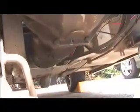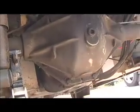Unlike the Commuta Car, the City Car does not have a hatch in back — the back is just a window, it does not open at all. Down here you can see the suspension is very simple: just a couple of leaf springs and some shock absorbers. And the motor, you can see back here, bolts directly onto the differential, so it's kind of rear wheel drive — works similar to how a pickup truck drive shaft would. Later cars had a different attachment where the motor was parallel to the axle instead of perpendicular to it.